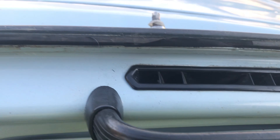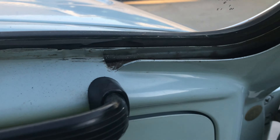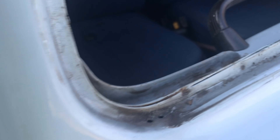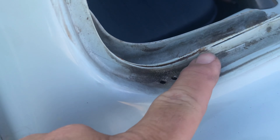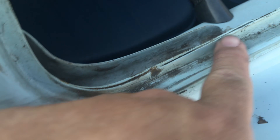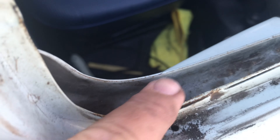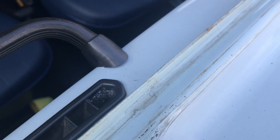We've got all the rubber cut out. Now it's just a matter of gently pushing the windshield out. All right, we have the glass out. Now it's time to clean up underneath here and make sure you don't have any rust going on. Get it prepped for the new glass. Also a good time to clean up inside here, clean your whole dash — whatever you need to do.